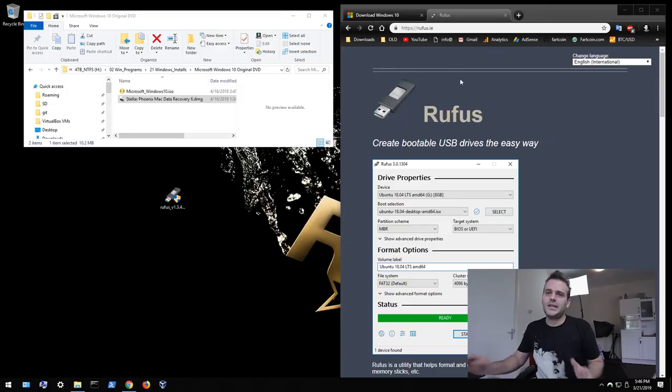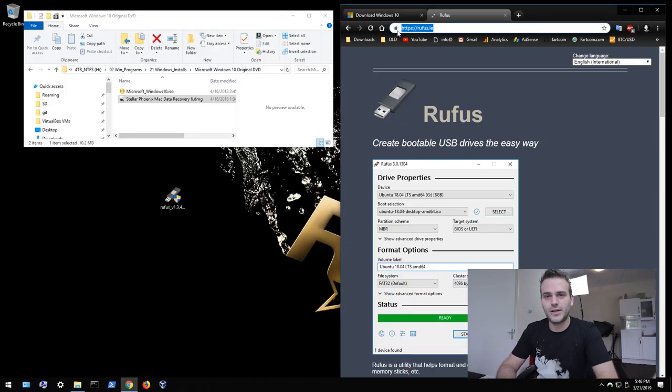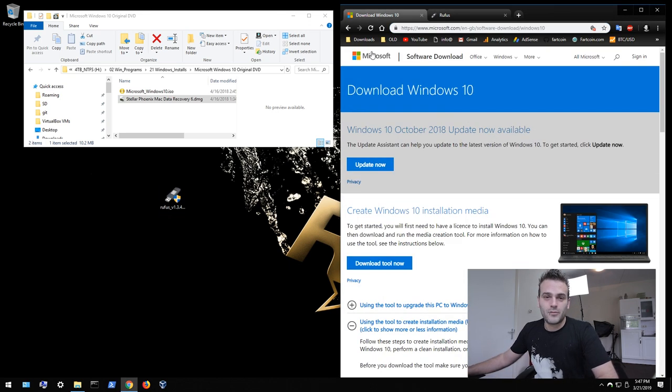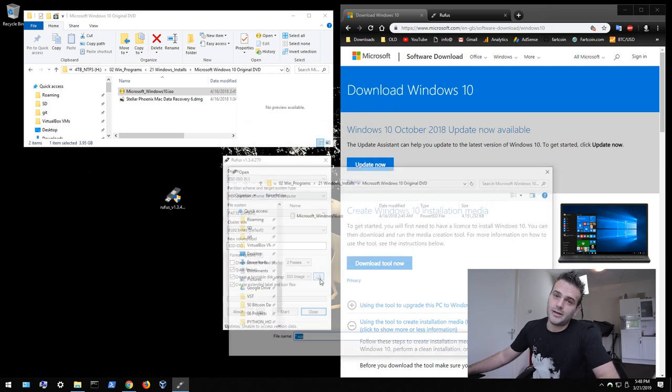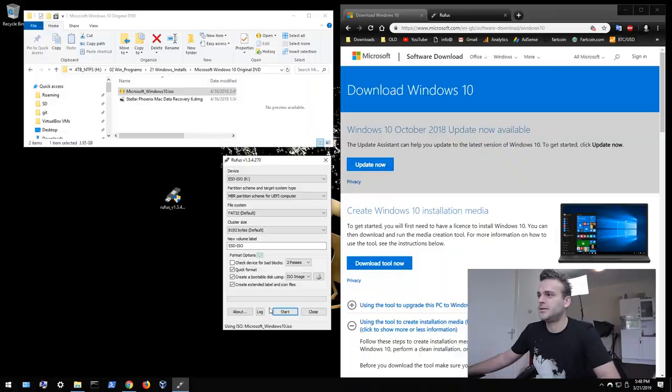It's a solid-state drive and I wanted a much cleaner setup, so I reinstalled Windows on this new SSD card. I downloaded the free program Rufus, downloaded Windows from Microsoft, and installed it on the new C drive. It works great — I definitely noticed a big difference. It also helped get the maximum out of my other SSD, which has a max speed of half a gigabyte per second, so transfers between the drives max out at that rate.